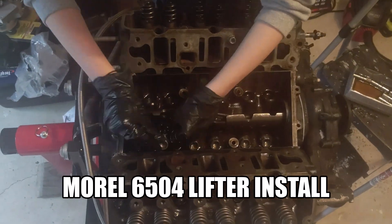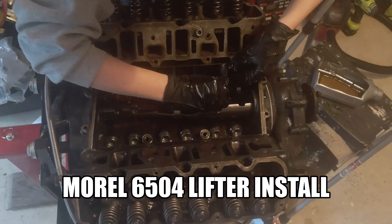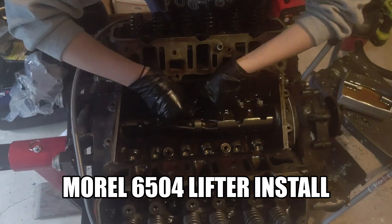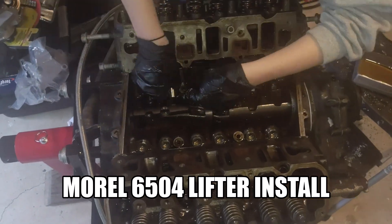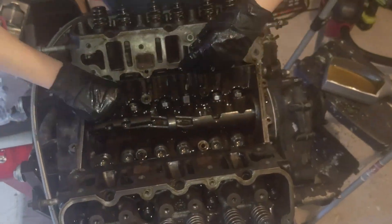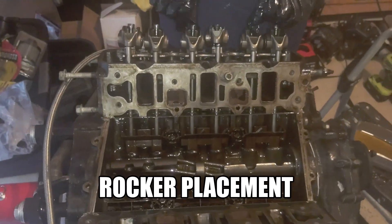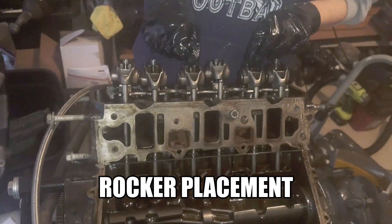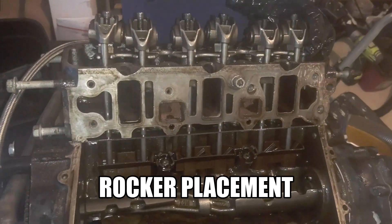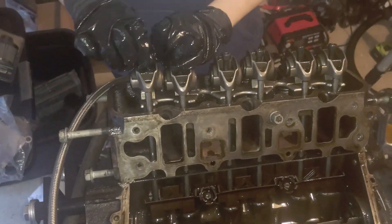This is my helper getting to take the new Morel lifters from their overnight oil marinade and install them. I had success on stock lifters previously, but I kept the RPMs just over 6,000. These upgraded cams are actually good for 6,500 to 7,000 RPM, which we'll start moving our way towards. These lifters measured the same as stock for push rod length, so we're still using stock push rods and rockers for now with 130-pound valve springs.